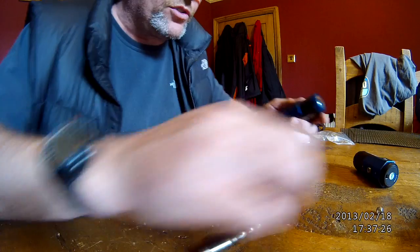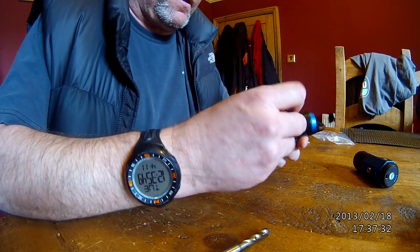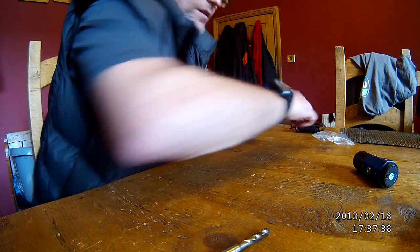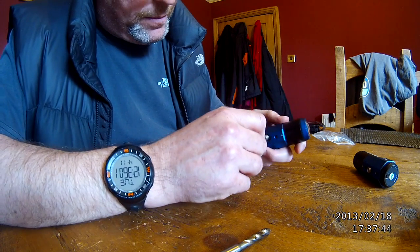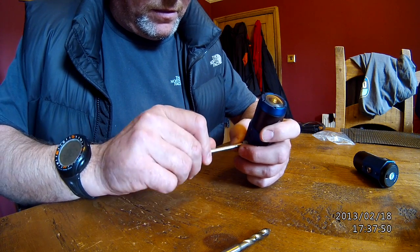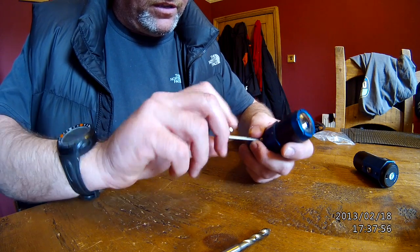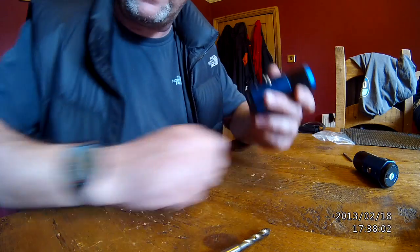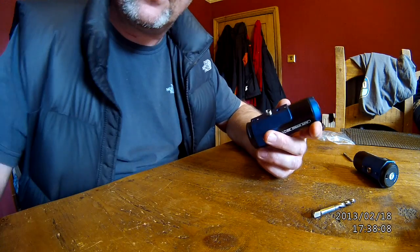Before I take the end of that tap off, I'll just offer a helicoil in. Get it in the right way. This is my homemade helicoil drive thing. Starting quite nicely, so I know I've got a half decent thread anyway. Right, so I'll have to take that out with the pliers. What I'm going to do now is turn it off. I'll go and grind that off, and then we can do that extra few mil, just for peace of mind. So I'll come back to you.